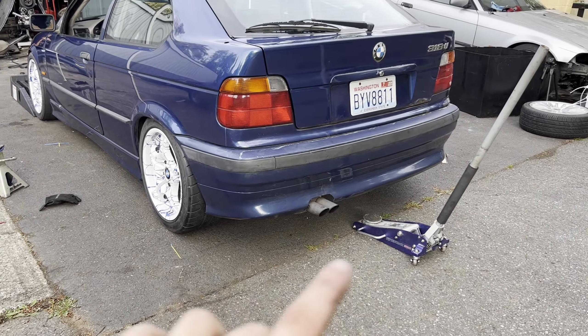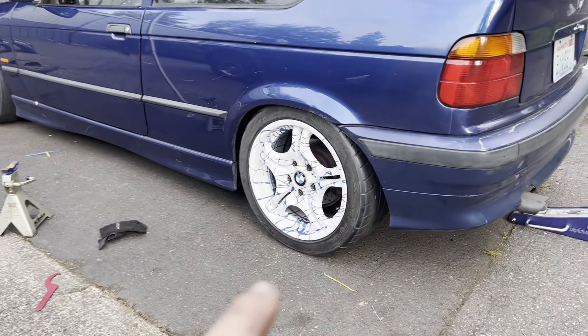I got the rear end all finished up with all the axle bolts nice and tight. I also added a little bit of preload to the rear coilovers because when I added the shorter springs I didn't shorten the shock, so there was literally no preload — the rear end felt super sloppy. I'm hoping that will help. Bad news on the hydro though: Cameron's brake guy is on vacation until the 23rd, which means he won't be able to help with the flaring and plumbing. I might have a lot of work trying to source everything myself.